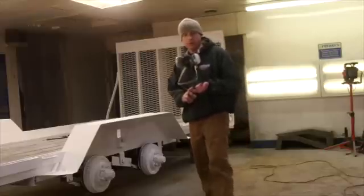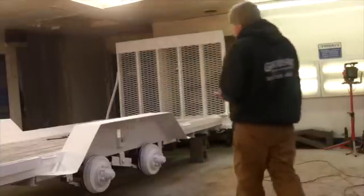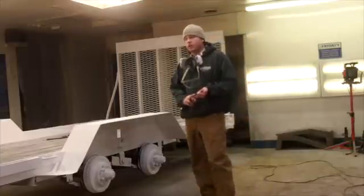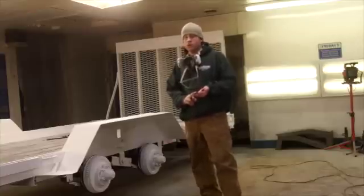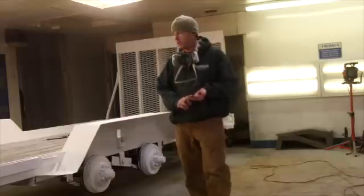But due to lower temperatures, it's just under 60 in here right now, I couldn't really hammer my second coat on, so I put it on a little lighter, but doing that I ended up with a bunch of overspray and didn't get as good a coverage as I wanted. So by the time I ran around in my third coat and tried to hammer it on, I just had enough to get through it, but I didn't have the gloss that I wanted. Usually I end up putting 3 coats on because I'm not that good at painting big stuff like this. It usually takes me 3 coats to get it glossy.